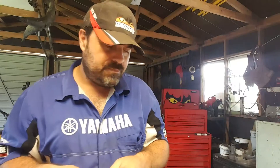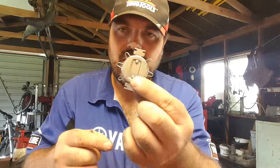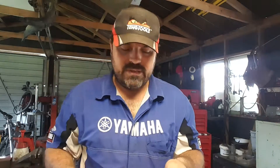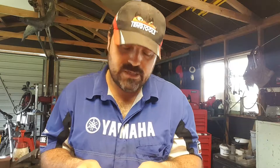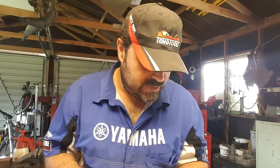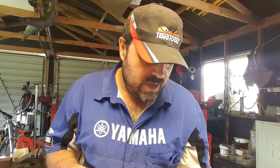So using this tool, it has a number of bits of wire sticking out around the side, and those wires are of different diameters. We're going to be taking the spark plug out of a little Yamaha SR125, a really old bike that I picked up in Scotland. We're going to check the spark plug gap on that — the specification is 0.6 to 0.7 millimetres. You're going to need to do a bit of research and find out what the spark plug gap specifications are for your particular vehicle.